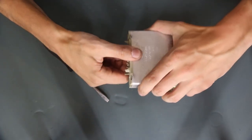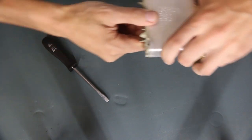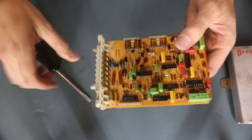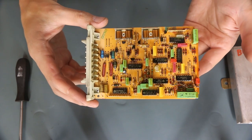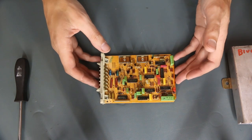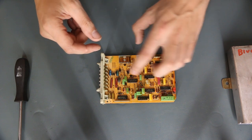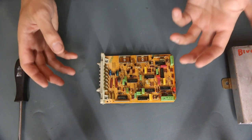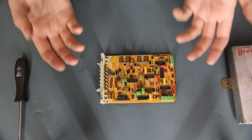That is all free, so we can grab a hold of this plastic, wiggle it — and there it is. It came out rather abruptly, but there is our circuitry for the cruise control amplifier. Now that we've got this disassembled, what we're going to be doing is essentially reflowing the solder joints and replacing these capacitors, because electrolytic capacitors tend to break down over time, and so these five capacitors may have failed by now.